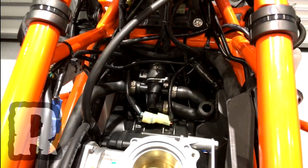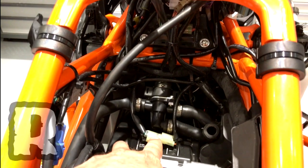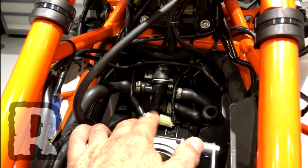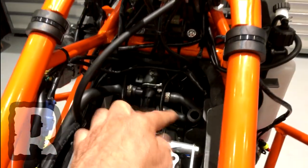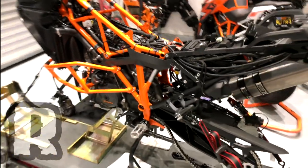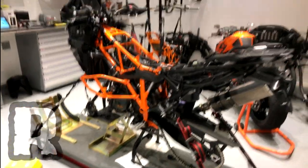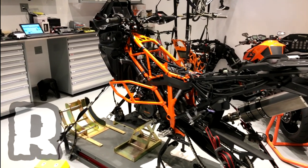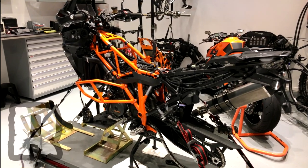That's the entirety of the SAS system — it's very simple. You've got a plug here, you've got a pairing valve, and it draws in oxygen. At idle, when you start the bike, it uses the low-pressure pulses from the exhaust to draw air from the airbox and pull it through these ports and inject it straight into the exhaust ports. That's really all there is to it. It's not as complicated as it looks. This does intimidate some people and we wanted to make this video to show you exactly where all this stuff is located on a bike, and to make reading the instructions and removing the emissions — if you choose to do so — that much easier. Thanks for watching.